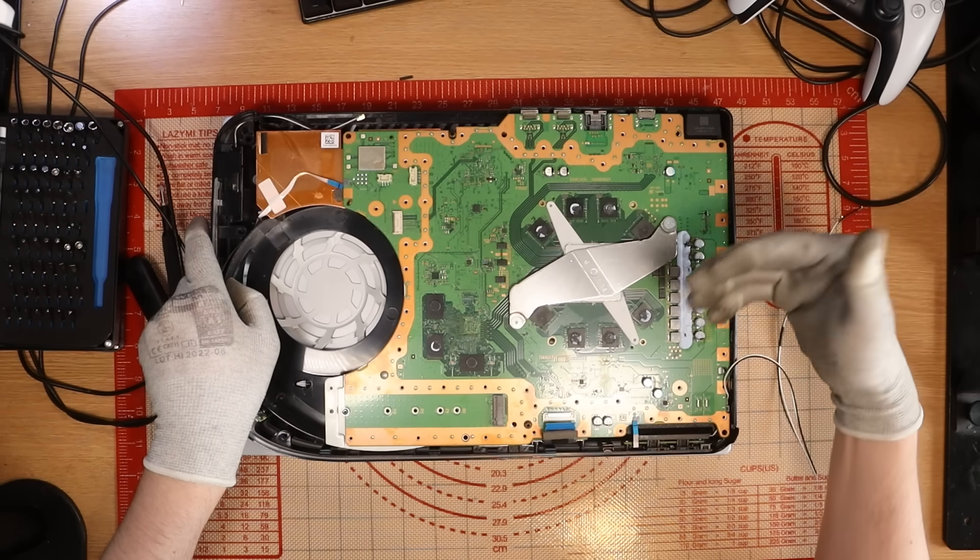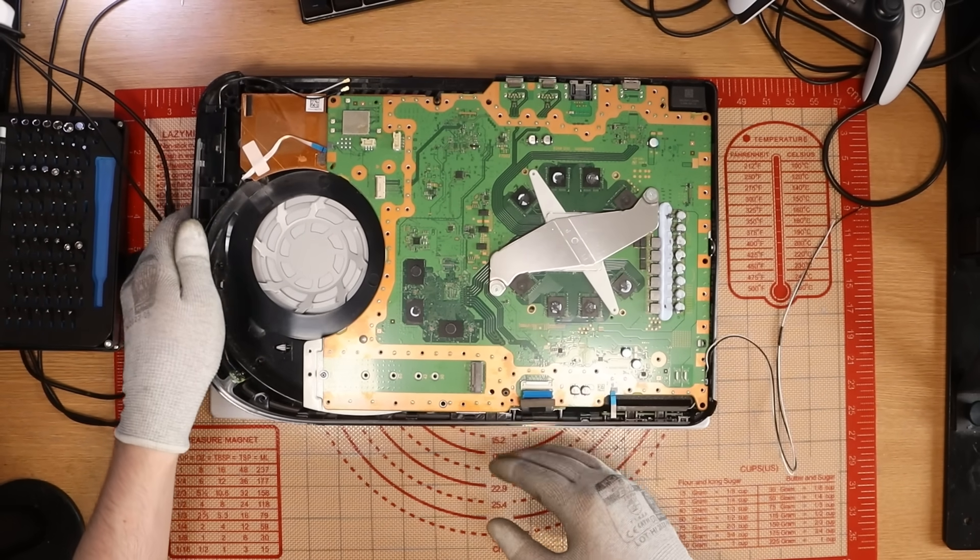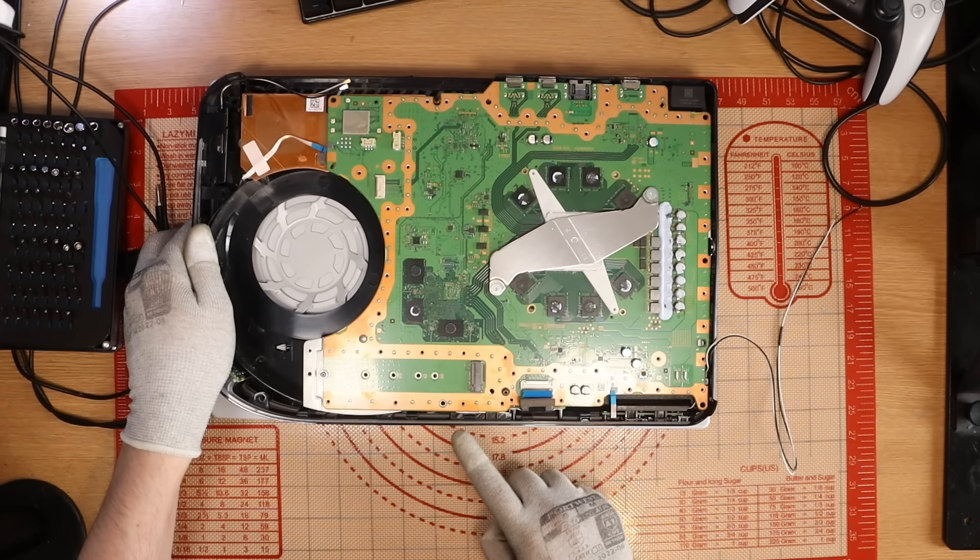In the Discord — I'll leave the link in the description — there was some back and forth on basic troubleshooting tips. And I suddenly thought: why don't I just disconnect the front panel board? This one here has the ribbon cable for the USB-A port at the front. Thinking that if one USB port fails, usually the rest of them go down too. Then I came across this: the front USB ribbon connector has some bent pins. I'm just flattening them out to see if putting it back in works. They've stayed down, so it might actually be okay — just a case of flattening them down.